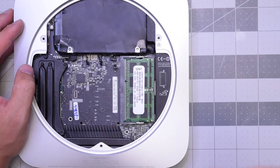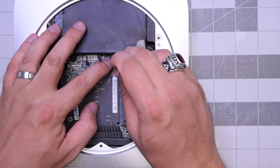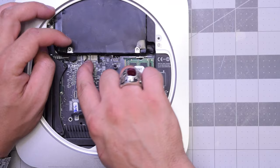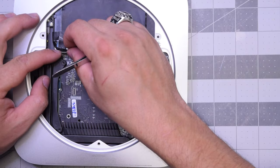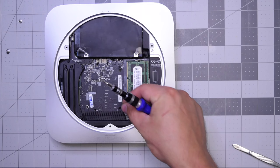Make sure you pull out any cables if they're jammed. We're going to go one by one — there should be six connections here. Start with the first two ribbon cables, popping them into place, then the sensors from the hard drive and from the optical drive as well. Once those are in, go ahead and plug in both the hard drive and the optical — make sure you hear that click and they're firmly in. Check all six connections before you proceed. And then that seventh one is the fan.